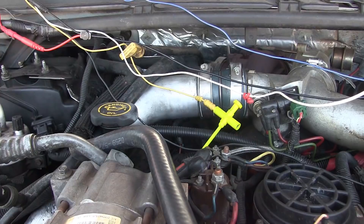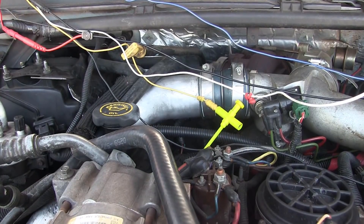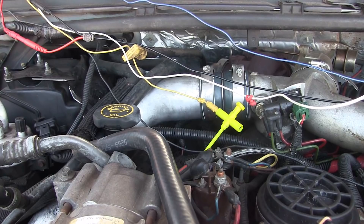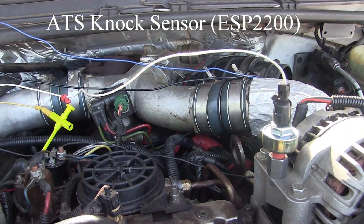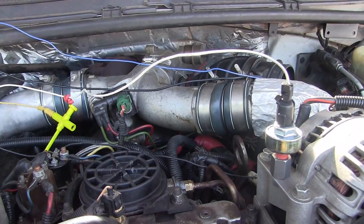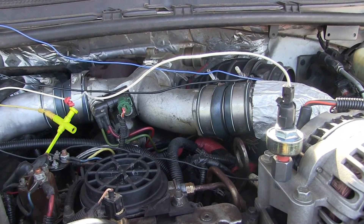The yellow trace is channel one and it's connected into the cam signal. There is no crank sensor on the 7.3 — there's just a cam sensor. That will give me the sensor reference which would be like a crank on most cars. Then what I've added is a knock sensor on this engine. This knock sensor is going to give me the indication if the cylinder fired or didn't fire and it's going to tell me which cylinder is knocking. Now that we've got this connected, let's go ahead and take this vehicle for a test drive.